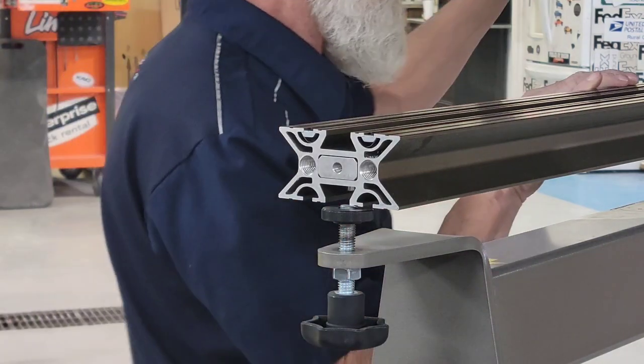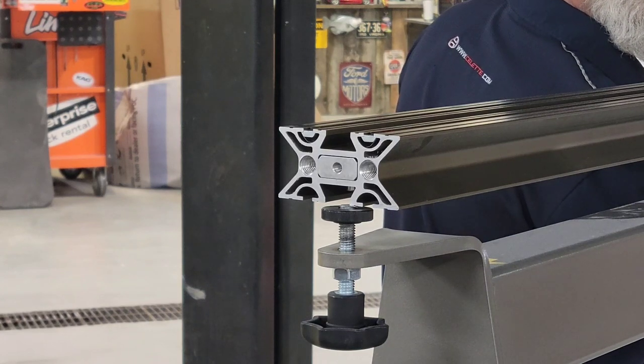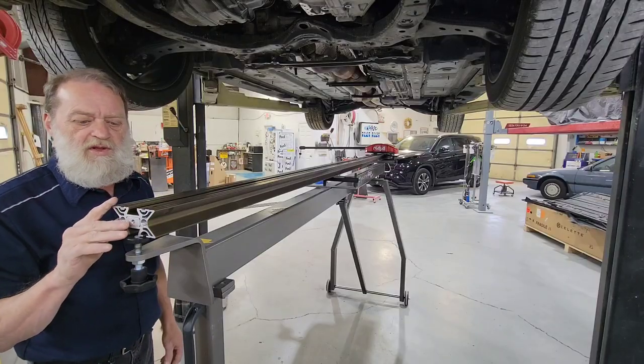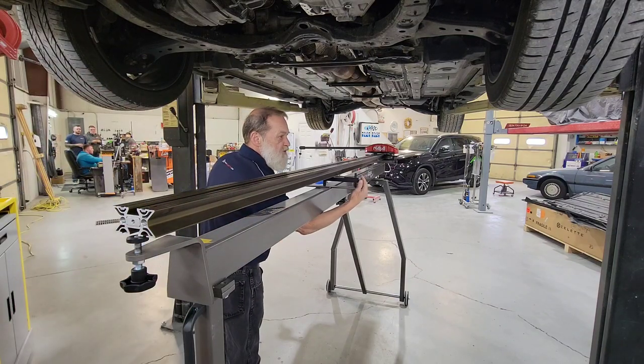On the way back to the measuring head, re-tighten the two screws here that you loosened previously. Once you've made your adjustment on the note on the tip, come back here and tighten up your two screws.